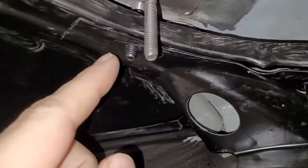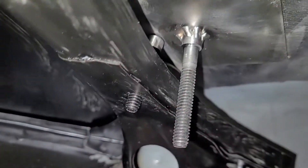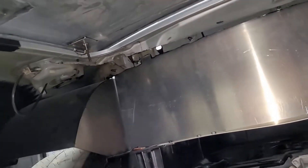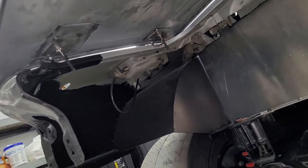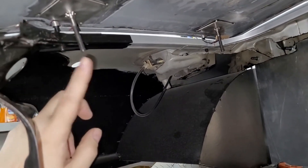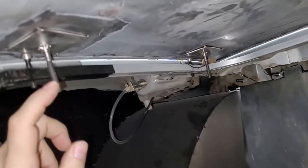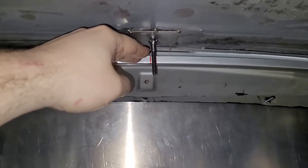We're going to take a caliper and accurately measure the distance from this hole to this hole. These are quarter inch bolts, so if I take this measurement and subtract a quarter inch - an eighth inch on each side - that gives the center-to-center distance between the two bolts. We're going to do that for all of these, then mark it out in a piece of steel and make our five adapters. Once they're built, we take all of this back off, bolt our adapters in, lower the trunk lid on, and put lock nuts - maybe dual lock nuts - so you can turn them up and down to raise and lower each individual area.